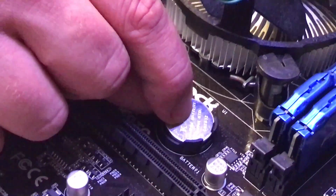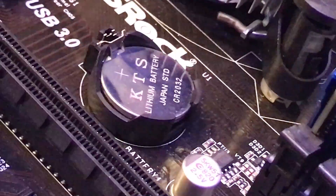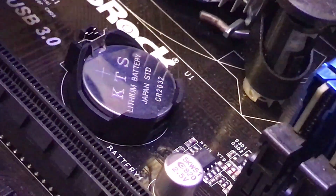With the battery out, you'd want to wait about 15 seconds as well. This is just a tutorial so keep that in mind — you don't normally just pop it in and out. Every motherboard is different as to where this will be located. Now we're going to put it back — you can hear it click. Don't forget to move your CMOS jumpers back — squeeze a little bit with your fingernail. There are our jumpers — notice where they are.